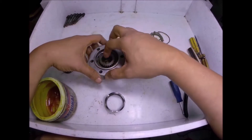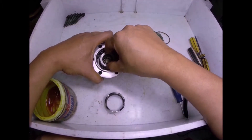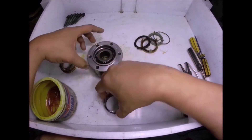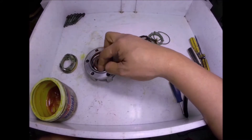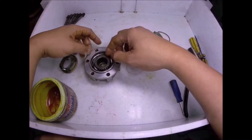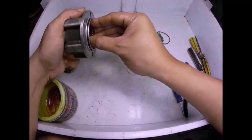To force lock this, all you have to do is insert this thing here with the gear side downwards. Drop it, then rotate it. As you will see, it's already in its fully locked position. Then you insert this spring here. The purpose of the spring is to prevent the disengagement of the locking mechanism while you are using your four wheel drive. As you will see, it's locked.